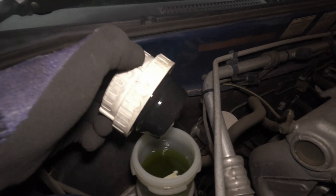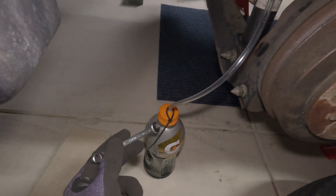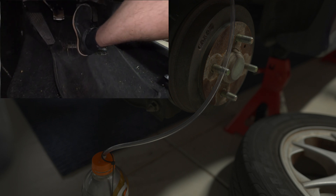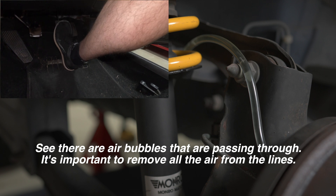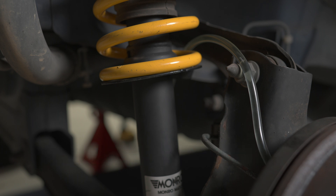That'll be right for one more and then we'll top it up before we do the front. On the rear here I've just got the tube hanging over this bracket — didn't need to use the cable tie on the last one so I left it loose, with the tube going down into the liquid. You can see it's got a bit of a green color. I'm monitoring on my phone connected to the camera so I can see the color of brake fluid without having to get out.